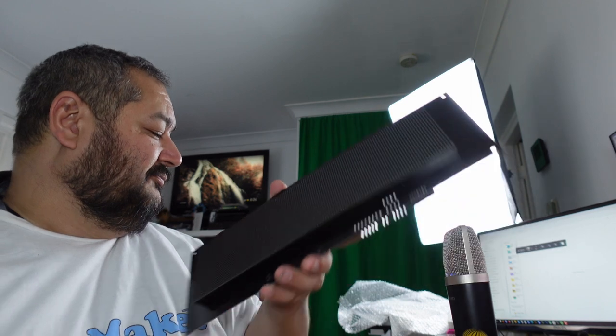Now the problem that we've got is that that display, being quite modern, is problematic, because it requires 5 amps as a minimum to run, whereas the old DMD only required a 12 volt rail of 1 amp, but it also had other voltages going into that board which were quite significant. This new board doesn't actually need those other voltages. So I needed to figure out how the power is going to work and how I can protect it from getting this extra voltage being charged through it.